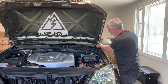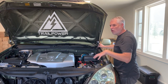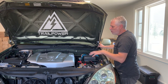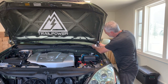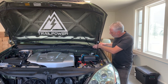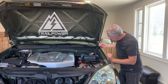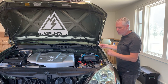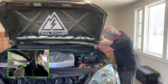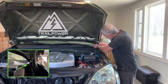Take this wire and run it over to the hinge — our starting battery is on this side of the truck. Bring the wire over to the hinge, which has a U-shaped section right where it attaches to the truck. Tuck the wire inside that U-shaped section of the hood support. There's also a hole already drilled there from the factory, which is really convenient. We're going to run a zip tie through that hole in the hinge and wrap it around the cable to secure it.